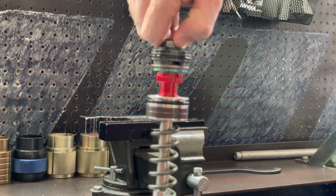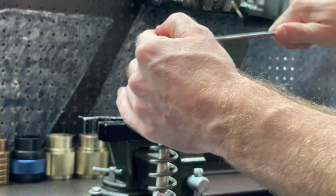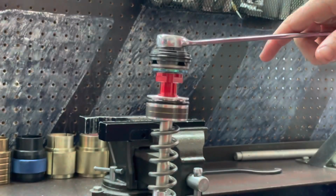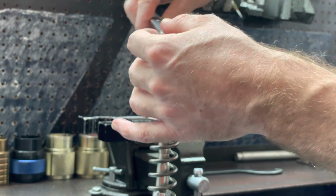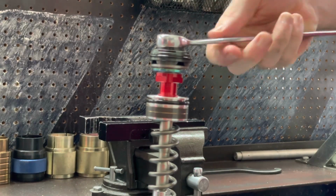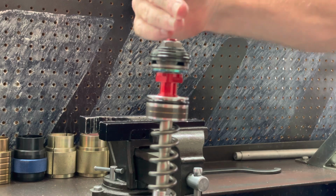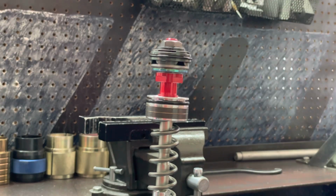So this nut has bottomed out. So we're going to torque it down. Excellent. So as you can see, we got about a quarter turn of torque out of this. So again, the wrench started here and we ended about here. We can just double check it one more time for our OCD. Perfect. So again, we snug the nut all the way down, then using our wrench, we turn this a quarter turn of tightness. So now we know this is Loctited and torqued down, and our subvalve is locked tight and torqued down.